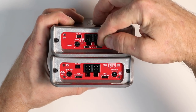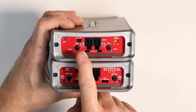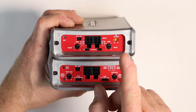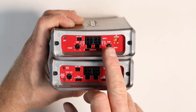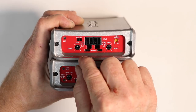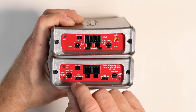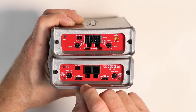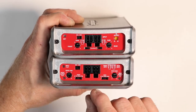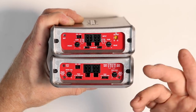The next set of switches are your crossovers. On the 300 it's a selectable high-pass or low-pass crossover. Even though you can't bridge the 300 you can still use a subwoofer on one and two or three and four without bridging — you just have to keep it in stereo — but you have a high-pass or low-pass 80Hz switch. On the 400 you get that same 80Hz high-pass/low-pass, but now it's specified as a Butterworth-style crossover at 12dB per octave. The high-pass is selectable at either 60 or 80Hz; the low-pass is just 80Hz.